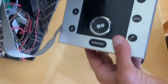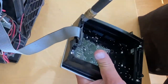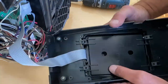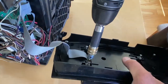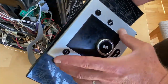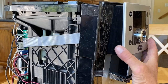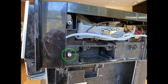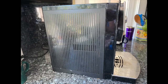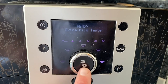After that, everything pretty much just goes in reverse. The fascia plate goes back on and is held in place with those four screws. Then the backing plate goes on and the whole thing fits back into the frame, held with four screws. I can test all the buttons to make sure they click and are making good contact. The control frame slides into place and gets attached with four screws. The sides slide forward and the back gets attached — and then there's the moment of truth.